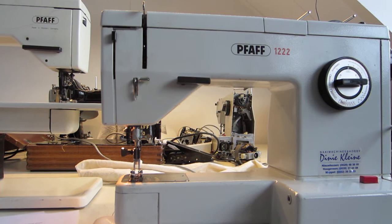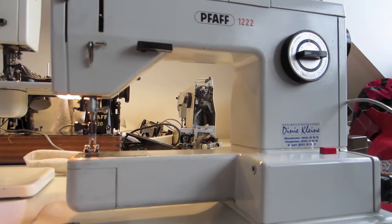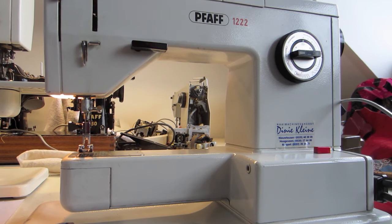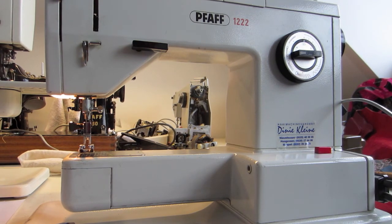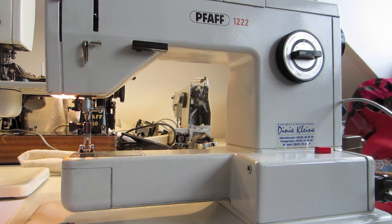So I mentioned before, if people use too much oil, the feed gear breaks, etc. And even worse, the engine burns. So you have to always check the engine, and you can check that by 2 things: use your nose, because you smell a burnt thing, burned oil, so you have to smell here a little bit, and check RPMs, but RPMs you can't check, you can only hear. So I show you what a good running machine sounds like.